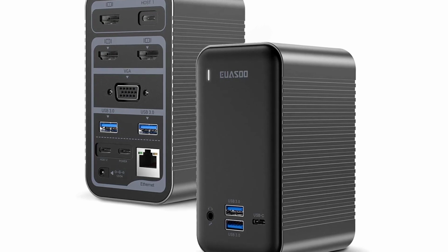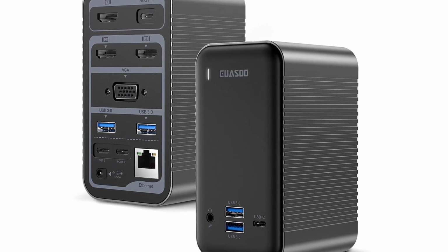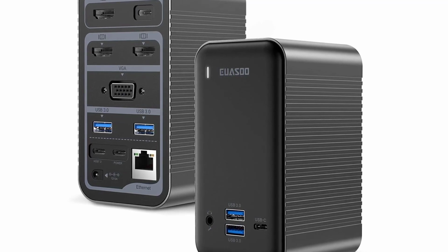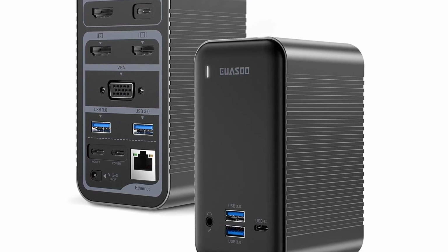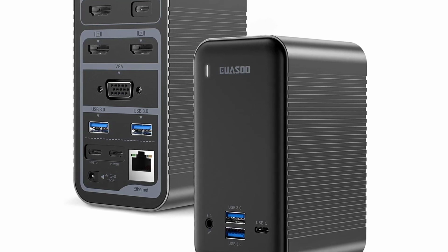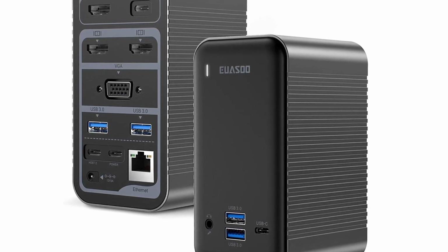For Windows, quadruple display is supported when you connect 2 host systems. For Mac OS, it supports triple display. Please make sure that your laptop supports DisplayPort Alt mode, USB 3.1 Gen 2 Type-C.